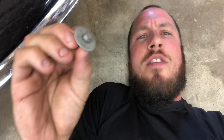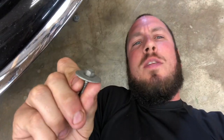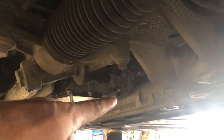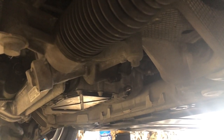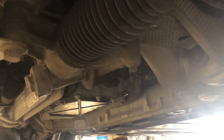All right, guys. So I've already started to do the oil change, but the under panel bolts for the plastic protector under the car are little 8mm, and you'll have 8 of them, 4 in the front, 4 in the rear. Literally take the plastic cover out from underneath the engine. After you take the plastic cover off that covers this entire bit, you're taking out this plug here on the driver's side of the oil pan. The plug is rather long, 13mm is the size. It has a little crush washer that I always recommend replacing. I've had luck with turning it over, but otherwise replace it every time because you might develop a leak. So just one of those things I'd recommend to you.